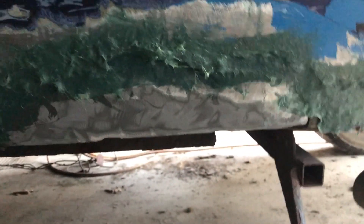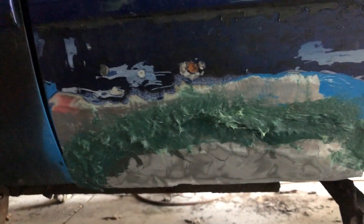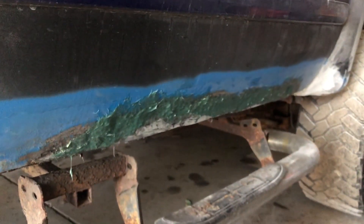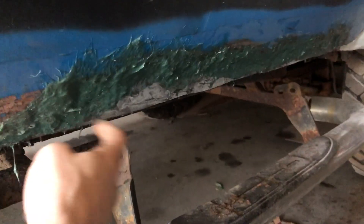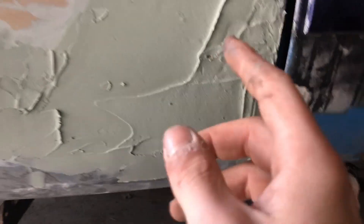If you've been watching, hit that subscribe. I've gotten all the pieces of metal in and they're all pretty solid. This Bondo with hair — fiberglass, whatever you want to call it — is very strong stuff, and I was actually able to glue this piece in with the Bondo with hair. It's not easy but after a few times doing it, it turns out really well and gets easier as you go. I got that done and I got this piece in down the door line, which is pretty good. I had an epoxy on this one but the fiberglass is what's gonna hold it in there nice and tight. I'm gonna grind this stuff down, same with the other side, and then Bondo over that and fill in any dents.